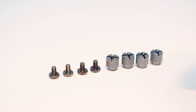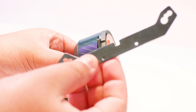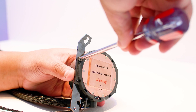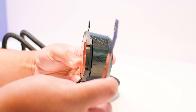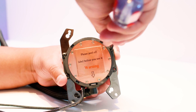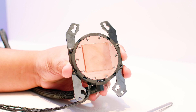Now let's get those brackets onto the block itself. On the side of the block, you'll notice some slots with little notches that line up with the notches on the brackets — just drop them in and they won't move. Grab the included screws and screw the bracket in, then rinse and repeat on the other side. Line up the bracket with the slot, slide it in, and tighten up those screws. Also, don't forget to remove the protective plastic peel-off sticker from the block — otherwise your CPU temperatures will be very, very warm.